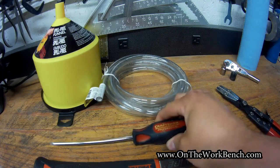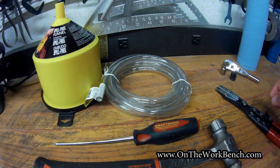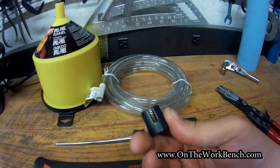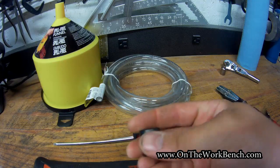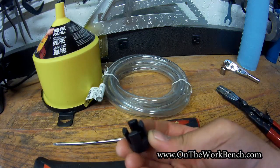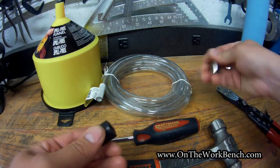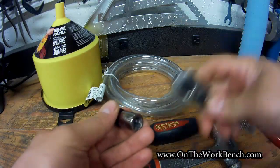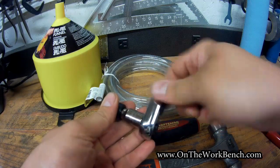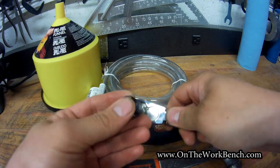You may also want a T30 screwdriver to remove the top engine cover so you can get to your upper radiator hose to bleed it out. To open the petcock, you can use your hands, a pair of pliers, or a specialty socket — this is a Blue-Point socket from Snap-on with a cross member that lets you open the radiator petcock. Stick it on the back of a 3/8 extension with a small flex-head 3/8 ratchet. Works great.